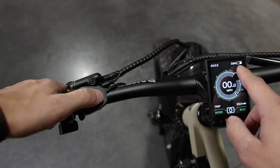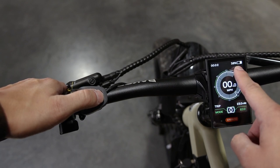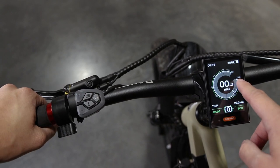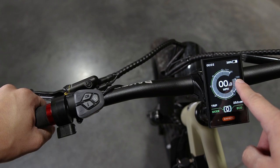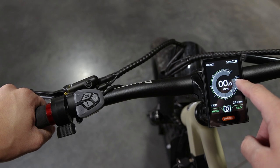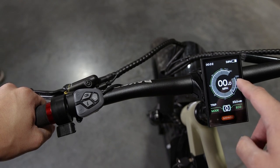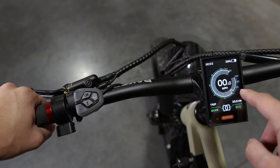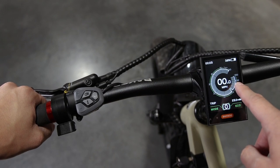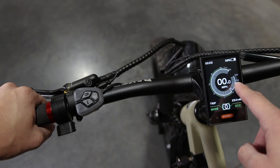With your display on, you'll see your battery life right here — we're at 38 percent so we'll probably take this back to the office and charge it. This is your speedometer. On the right side you'll see 1500, meaning that's your wattage range from zero up to 1,500. It has a max output of 1,500 watts but you're going to see it stay around the 1,000 watt area. If you go through the settings menu, you can change it so it only hits 750 and falls under a class one e-bike classification.